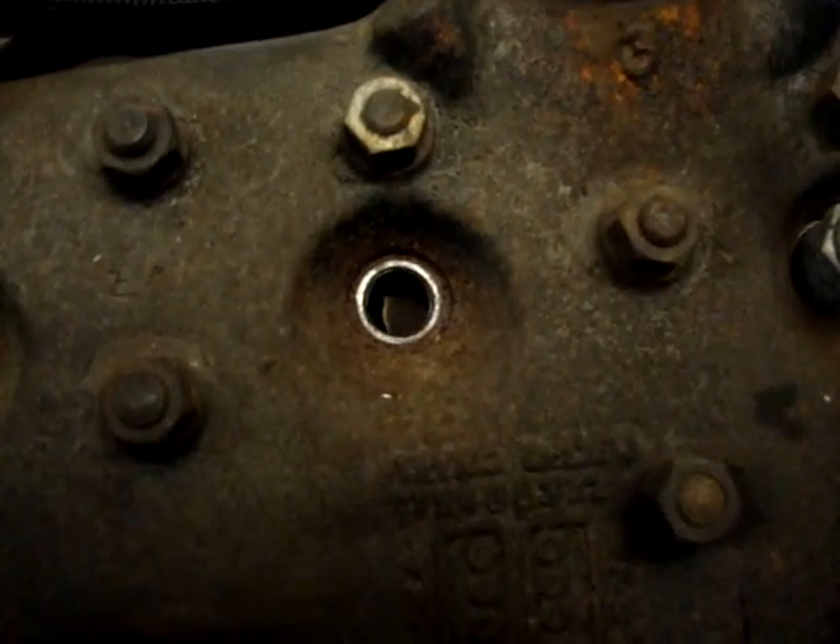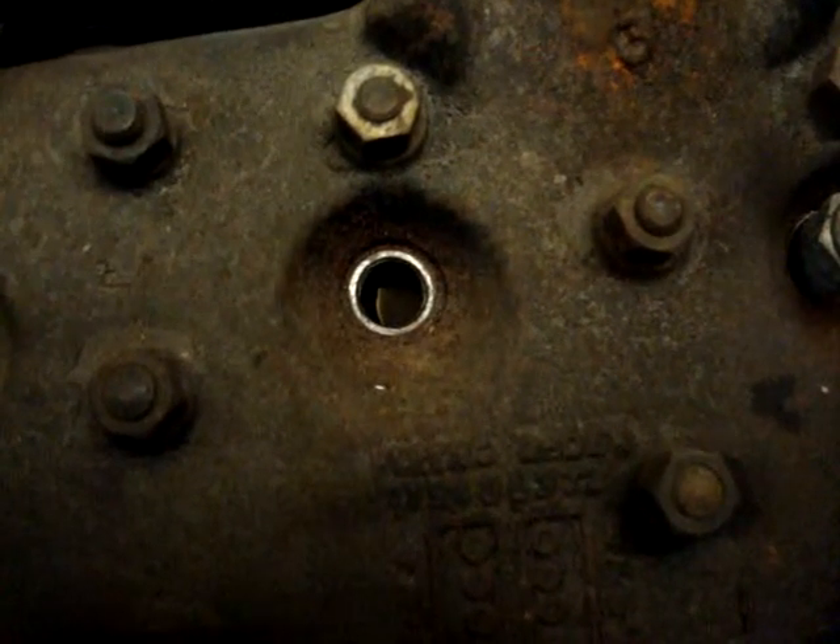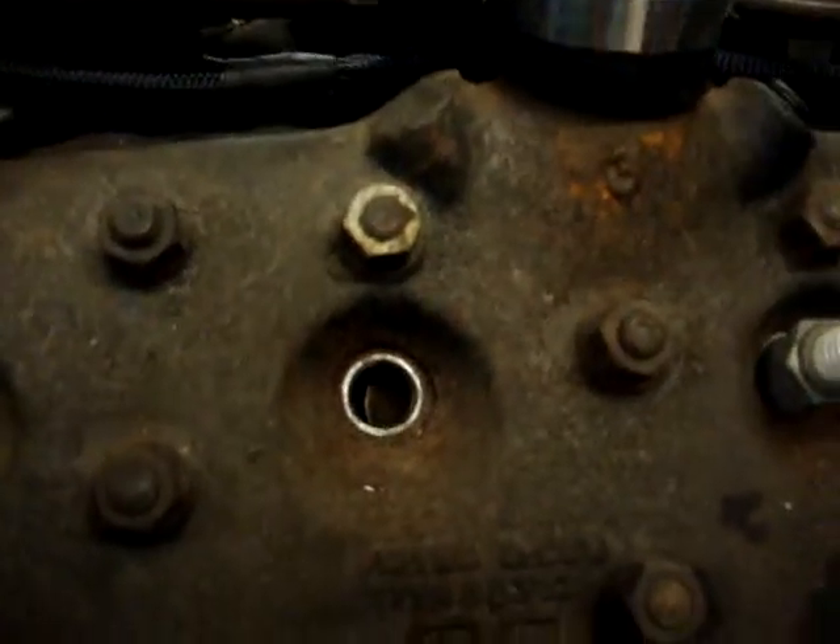Now what I'm going to do, I'm going to turn the engine over until that one closes and the inlet valve just starts to open. I'm going to do that in a bit of a tricky way on this car. This is the only way I've got of turning it over at the moment — this is the gearbox. I'm turning it over; it's engaged in top gear, just turning it over gently like this. The axle's going round, but that don't matter.